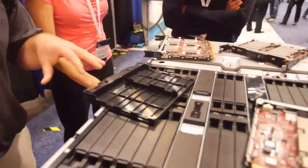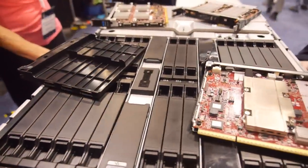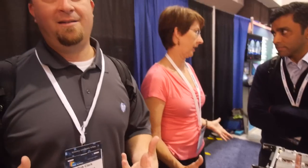When you said 90% as powerful — on the low-end Calxeda side? No, on some of our x86 cartridges, comparing to traditional lower-end x86 products that scale-out guys are using — like a lower-end E3 compared to an Atom Centerton-type box.